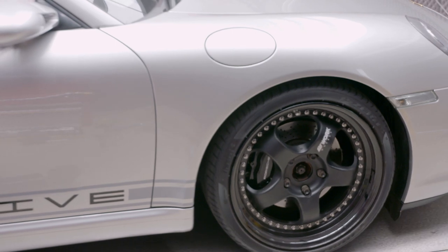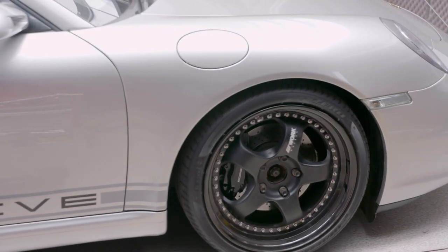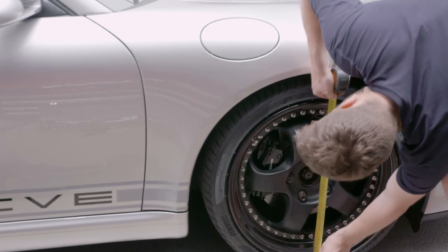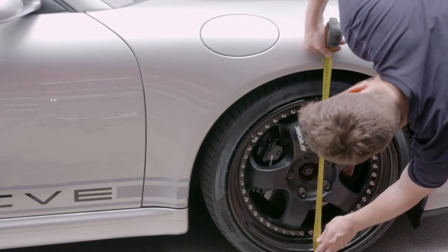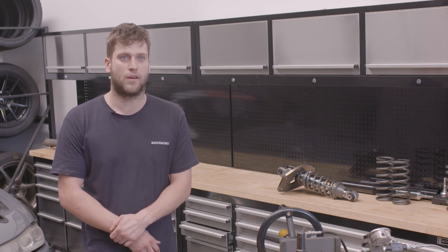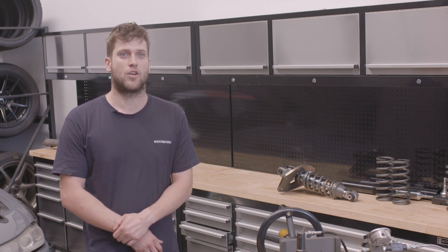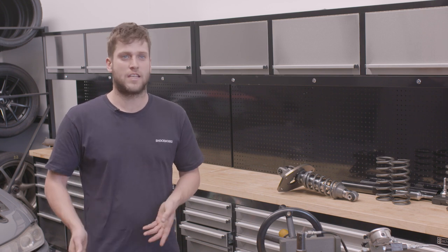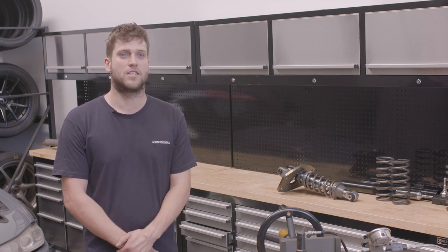Once you drop the car on the ground, roll the car forward and back, because if it's just lowered onto its tyres it won't be sitting into its full travel. Then get your guard heights. A lot of people check the ride height, go for a drive, and find the car has lowered itself 10–15mm. So sometimes I'll set the heights, go for a 5–10 minute drive, come back, and then get an actual baseline of the heights — saving you the back-and-forth of lowering and raising repeatedly.